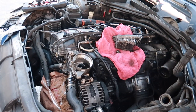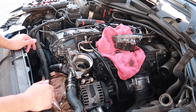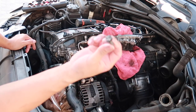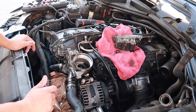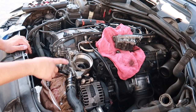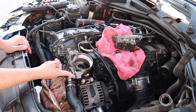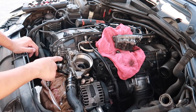So this is just a quick update. I did stop a little bit because I'm also taking care of my son. There's a bolt that goes under the transmission hoses, which is just a 13 millimeter, and the hoses come out. There are three bolts right here - they are torx but you can use a 10 millimeter to take them out. This is one gasket that gets replaced, and it looks pretty worn out, so it's a good possibility that the coolant and oil could have been mixing.